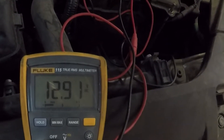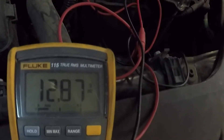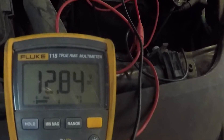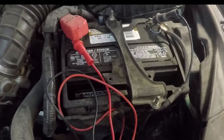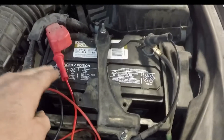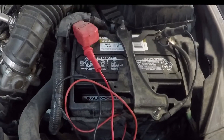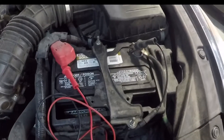When we first started this test earlier, it sat for a little bit and was at 12.5. It started at 12.9 and went down after I cut the vehicle off — so resting volts were a little higher. A battery isn't going to go bad all at once; individual cells will go out and you'll notice a slow cranking condition. If you notice slow cranking, that's when you want to think about testing your battery so you don't get stranded.